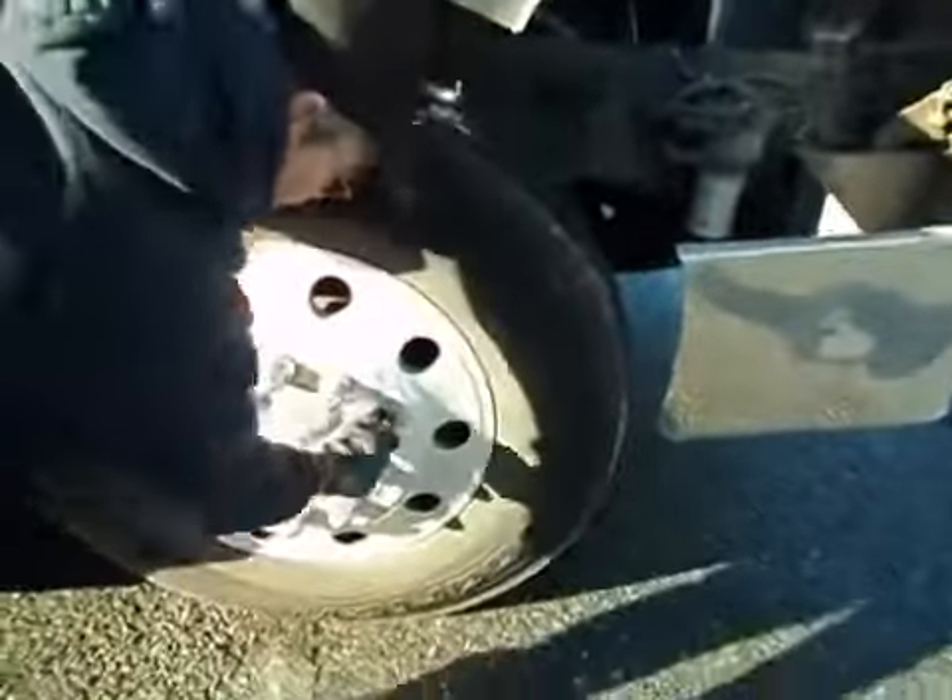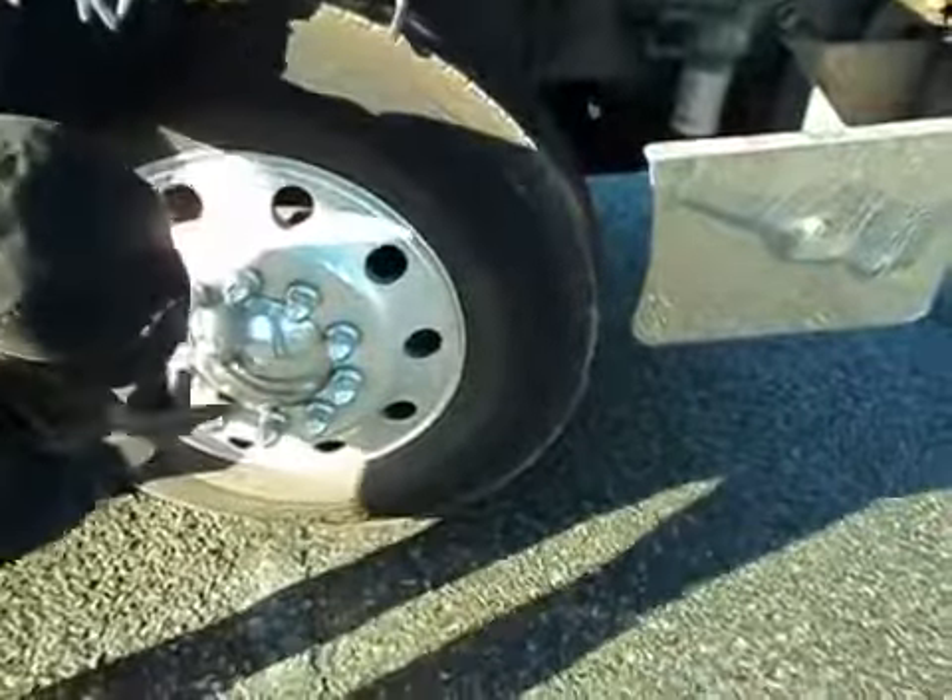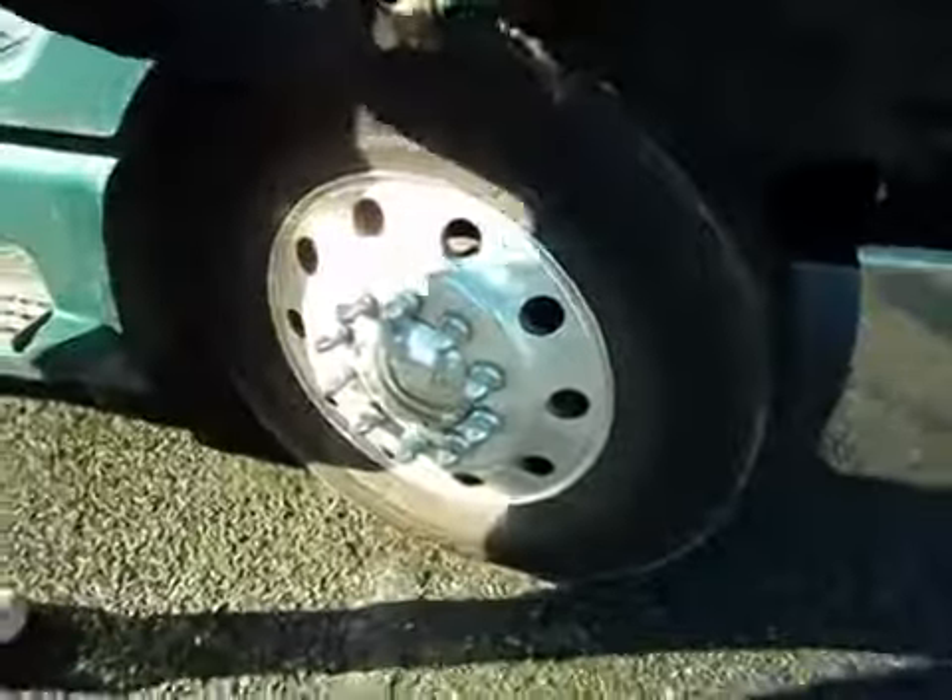Airlines: there's no audible leaks from the airline that goes to the brake chamber. There's no damage to the brake chamber. My slack adjuster — I'll just check it. I put the tool in there, give it a pull. I have half to three quarters of an inch play, which is within tolerance. Working my way out — inside the tire there's no rips, tears or bulges. Even adequate tread across the top. There's no rips, tears or bulges on the outside. No cracks in the rim. Lug nuts are all nice and tight. No leakage under the hub. No audible leak from the valve stem.